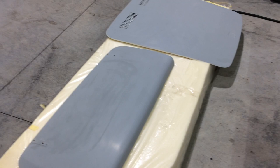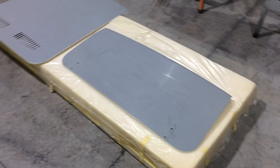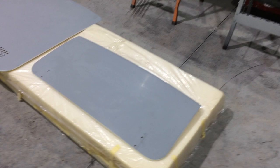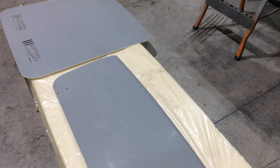I've been going for about an hour and a quarter so far. Probably an hour and a half, really. But the reason I like to do this stuff wet, I know a lot of people like to do it dry, like Joe Souza. I just find with this stuff especially, it just clogs the paper instantly. And there's no dust. And this is just the way I've been shown how to do it. So this is how I do it. Everything's clean when you're finished. It's not a bad system if you can do it like that. But do it whichever way you feel is best for yourself. Whatever works for you is good.